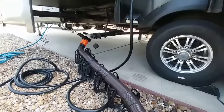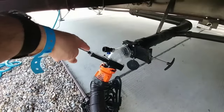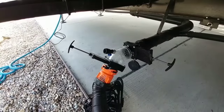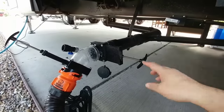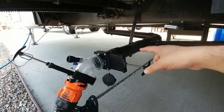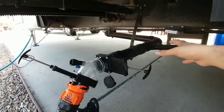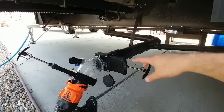My sewer hose is a Rhino sewer hose, and at the drain point I use one of these clear adapters that has a hose fitting right here. It gives me the ability to pump water back into the system and pull it out if there's some type of a clog. I do have a black water flush system on the RV itself, but this is a good backup. I highly recommend getting one of these valves as well — it goes at the end of your drain and you're able to close it off, because sometimes water and waste material backs up in the system, and if you don't have this in place, when you take the cap off, that water can break loose and flow out, making for a real messy situation.